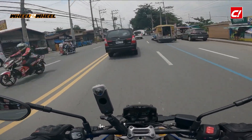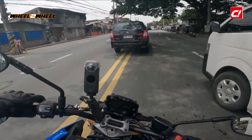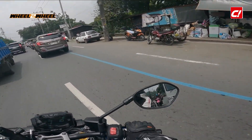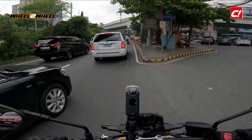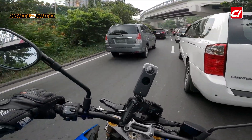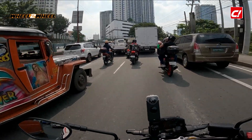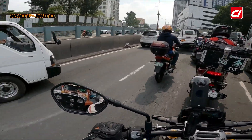Next, the tires. These Dunlop Road Sport 2 tires are a really big improvement over the old Dunlop D214s. They give more feedback on what the tires are doing, their interaction with the road, and they have a better profile — not as lazy as the D214s. They have better siping and will probably last longer. As for the rear shock, the original one didn't give that much damping — even if you fully closed the rebound damping adjustment, it just didn't hold that rebound for long. Now it's improved: at about a half turn from fully closed, it's slowing down the rebound. The front has been revised slightly too, though I didn't have any problems with the first-generation front end — it was already good.